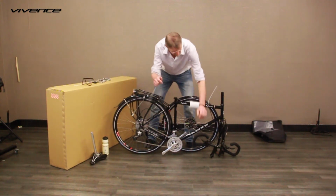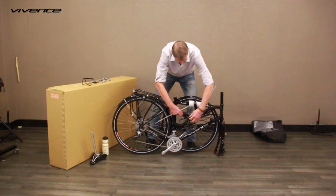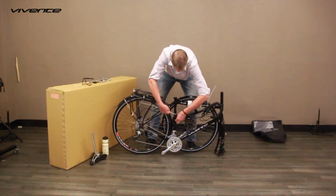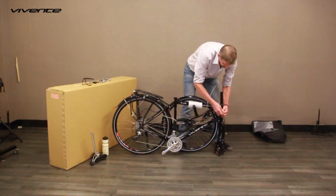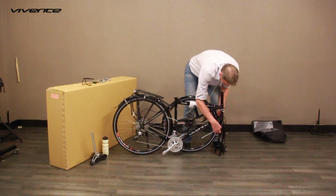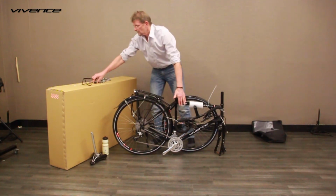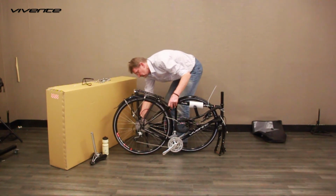With a bit of protective padding for the frame, locate, then attach the handlebar assembly to the right side of the bike. If you have drop bars, the drop or lower sections go through the frame so the stem is flat on the right side of the frame. Attach the front light with a zip tie. Remove the kickstand and put the screws back in the frame.